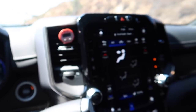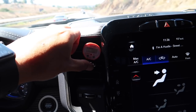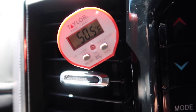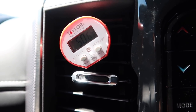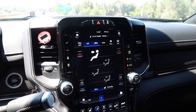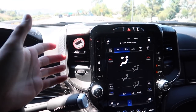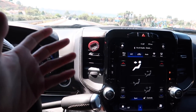At fan speed three, it still reads 50.5, 50.6 — looks like it's sitting at 50 degrees. I want to compare it to another truck. I did compare it to Louis's truck and his was coming out the same. I don't know if that's normal or if Ram trucks came from the factory low on freon. We should take this to the shop, hook it up to the AC machine, and see if it's low.